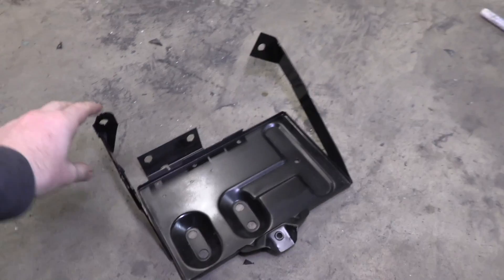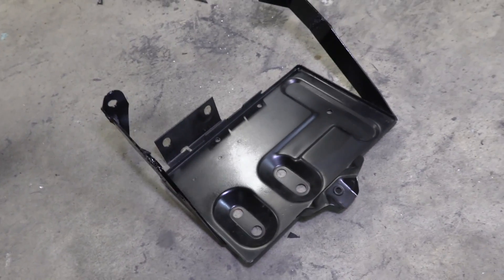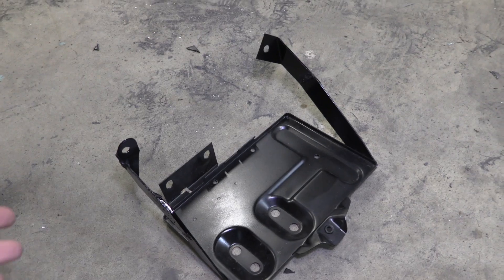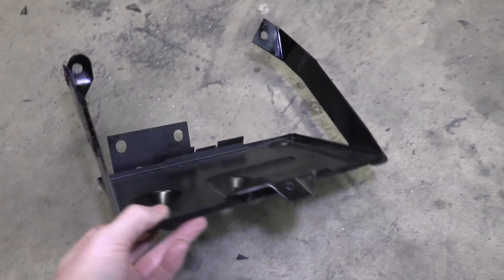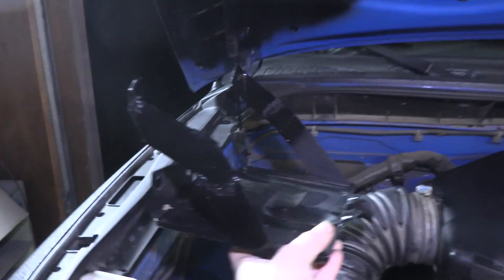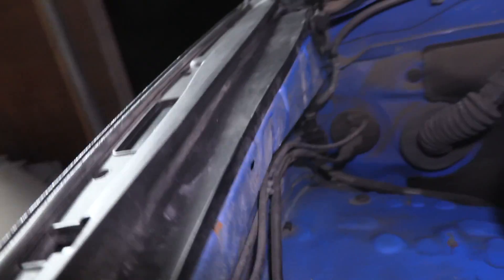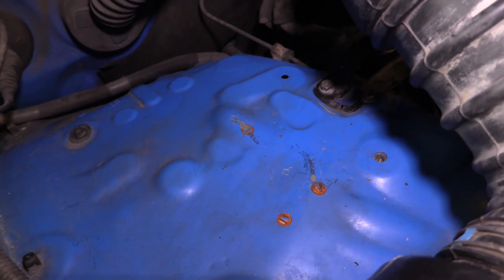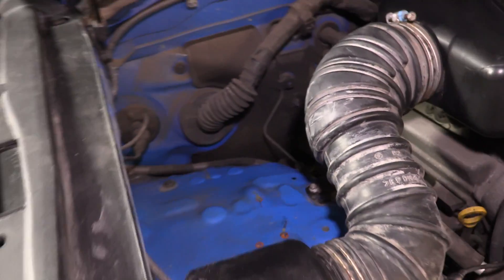Just finished making modifications to the battery tray. I realized at the beginning of the episode I kind of pitched this as a quick DIY, but look online yourself — you might be able to find one of these battery trays for your specific application. But dual battery kit prices are sometimes just as expensive as buying a welder and a cutoff blade to do the same thing I did. All we did basically was change the angle on both arms — cut them, weld them, paint them up. We're going to mount this in the car now. One bolt goes here on one of the arms, one goes into the place that's already threaded, and then we're drilling into the wheel well and using nuts, bolts, and very large washers to get a large footprint, because these batteries have a lot of weight and you don't want the bolts ripping through the metal.